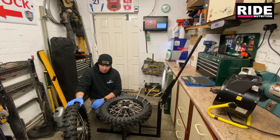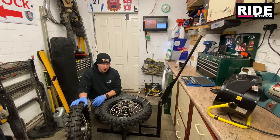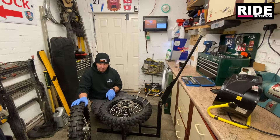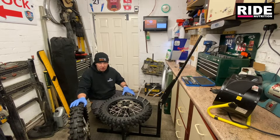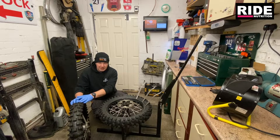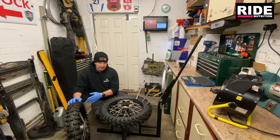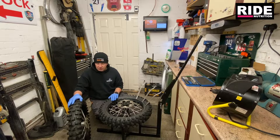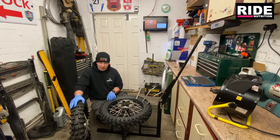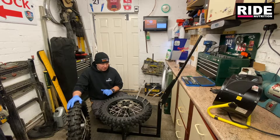The plan was to put this wheel back on the KTM, but I've decided I'm going to put this tube on the GPX wheel. There are a couple of reasons for that and I'm changing the tires as well. The tire I used for dawn to dusk is not a road legal tire, whereas this one is. They both look the same but they're not - they're both Mitas 754 but one is M and one is P, and that's the difference: road legal versus not road legal. So I'm going to use this road legal one on the GPX.